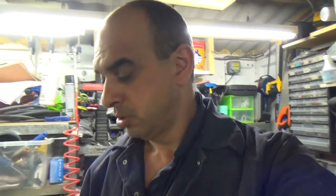Just a last minute update on the BMW underside preparation work. It was a satin finish, the top coat that I bought, or the POR15. But I had a little tin of the gloss finish, which I did the inner arch with, and I actually did like the gloss finish effect, so I decided to get some top coat POR15, which is this stuff. But apparently you can't put this straight on top of cured previous POR15, so I've had to go ahead and buy this stuff, which is self-etching primer. So basically I've scuffed down the underside that I did. I did two coats of the satin POR15, but I'm not going to be going under there again, so I might as well do what I want now and get it finished.